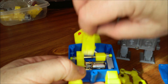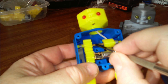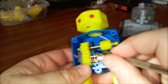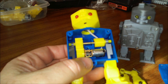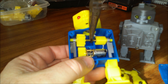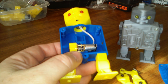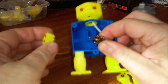Take that off and the clamp will come off and you can see the N20 motor. This one is built with a 1/8-inch shaft, but a 3-millimeter shaft would also work — there's only a few thousandths of an inch difference. There is a washer here and here that helps keep things working a little bit freer. When you assemble it, you put this whole crank assembly in as one unit. It just pulls out just like that — that's the way you put it back together too. The motor will come out, and this gear is on pretty lightly; you can just pull it off by hand.